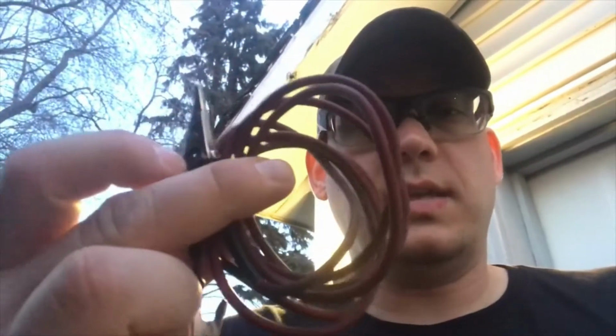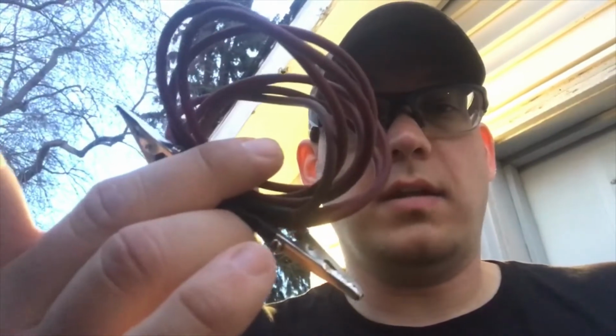Basically, you just hook a ground wire from the sensor wire to your battery, so to your negative, your ground on the battery. All you need is one of these guys, a little feeder line with two alligator clips on it, and then turn your key on and see what the gauge does. You can do it in the reverse way too: if you ground it out, hook it up to the negative of the battery, and it pegs down at 0, or with power to it it pegs out at the top, then you know it's working fine.